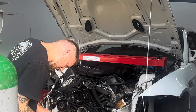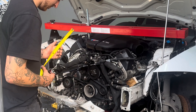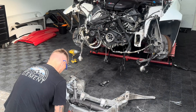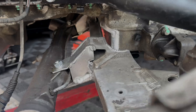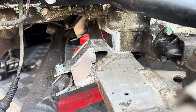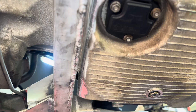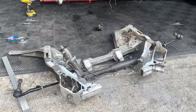With Toby here, we managed to get the V10 in and supported on a brace, and started measuring up exactly how we were going to modify the subframe. It wasn't long before that plan was being put into action. We modified the back of the subframe in order to take the sump — which was also modified — and also the steering rack, and then had to modify the front of the subframe too.